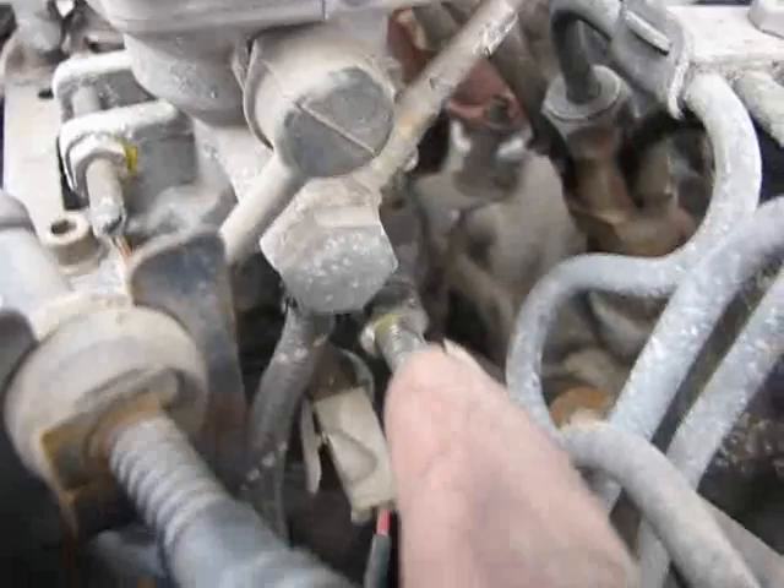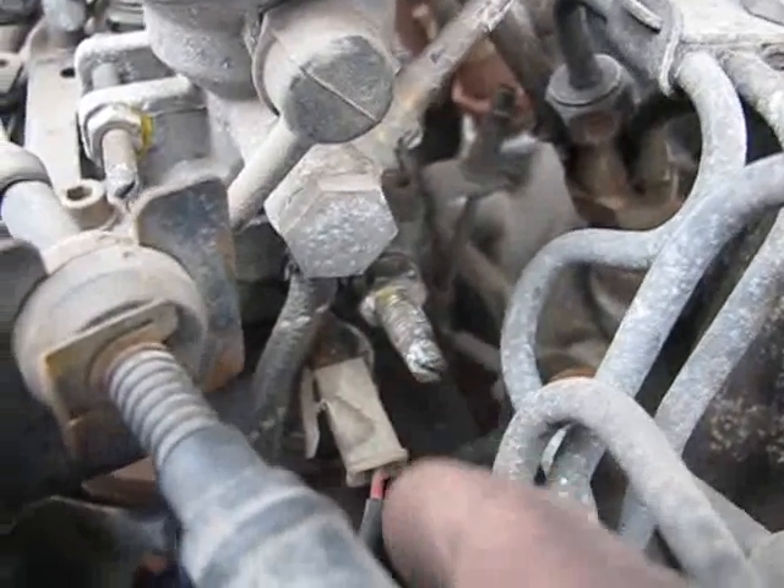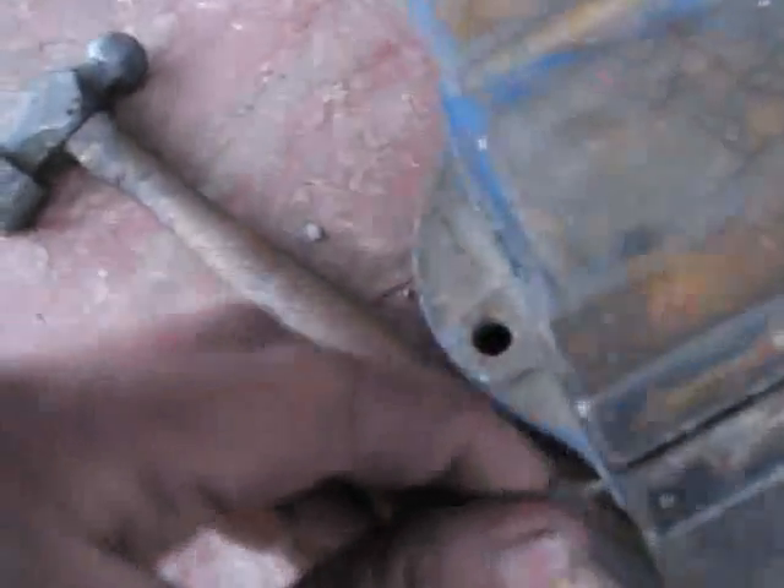I'm tinkering with the VW, it's crazy. I did the max fuel mod - there's a screw with a collar on it. What you've got to do is break that 13mm nut off and loosen it, then unscrew that screw - it's got a collar on it. All I did was put it in my vise and hit it with a hammer, and Bob's your uncle - collar's off.